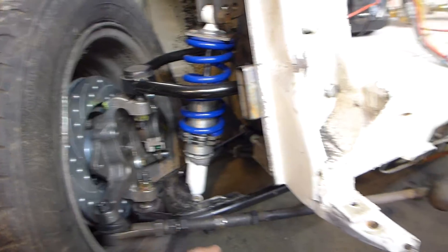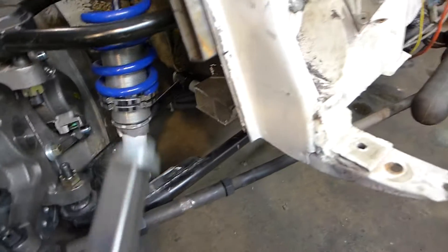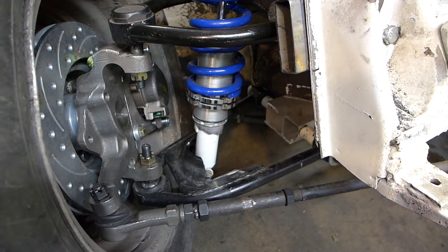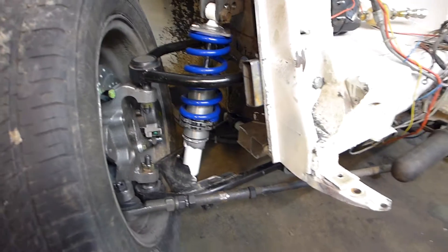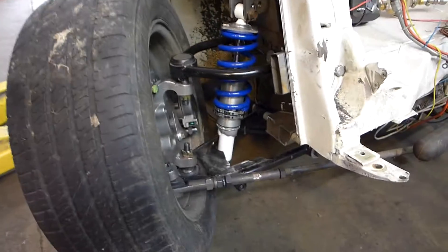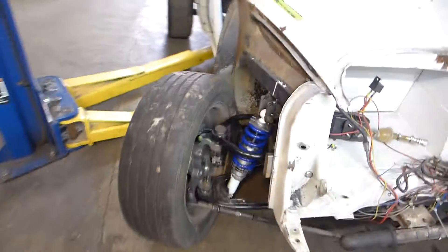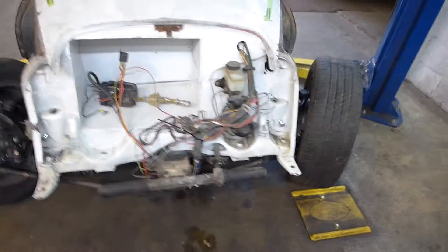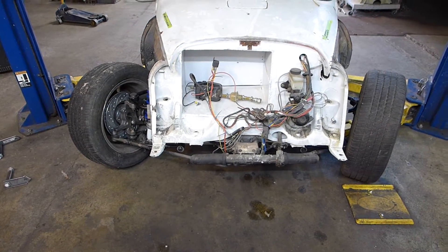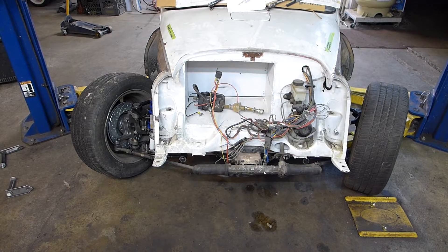Basically a rear steer setup with the stock Subaru 360 front rack and pinion. I had fabricated these kind of hokey brackets to try to get my angles right, and realized that I can't just adapt something to make it fit — I've got to follow some rules. I've been doing some reading and studying, and my angles were all wrong. For example, you can see how this tire here is tipped out quite a bit, and this one not so much. That's called Ackerman's angle or Ackerman's principle, and that wasn't happening at all with the way it was before.